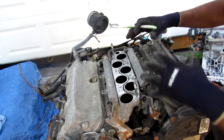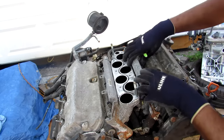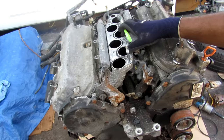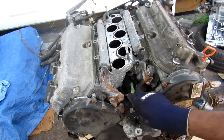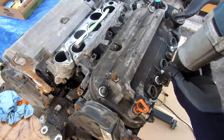The air intake is actually split down the middle — this half comes off with this head and this half comes off with this head. Some people are able to get in with a wrench and loosen it up, but in my experience they clash each other and you can't really get it out without taking the whole head off. It's unfortunate that you have to take off the head to get the intake off, especially if you need to change a knock sensor or this bypass hose. At least the oil coming out of here looks like oil and isn't mixed with any coolant or water. Next up I'm removing the valve cover.